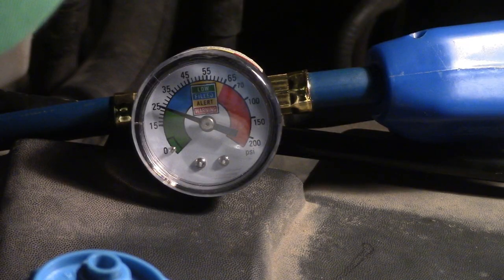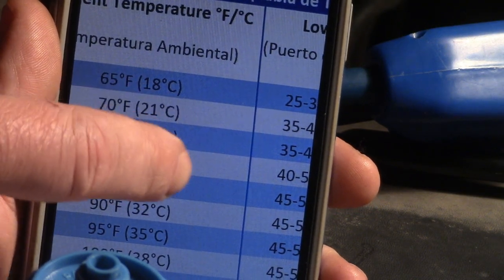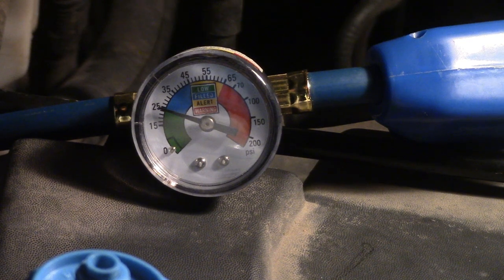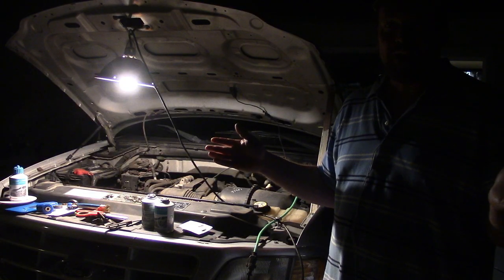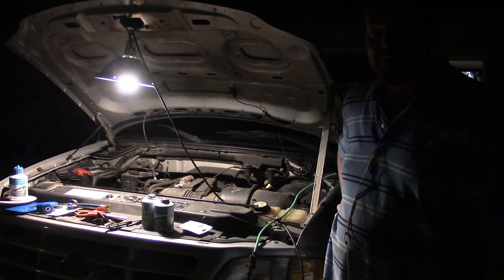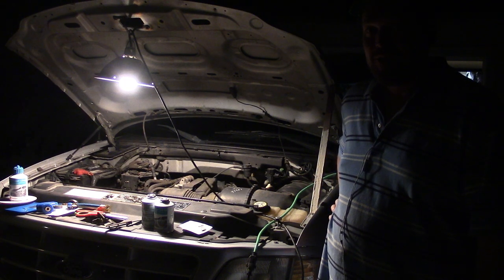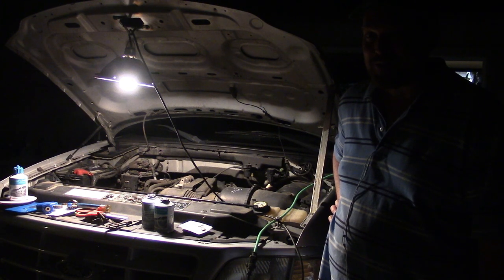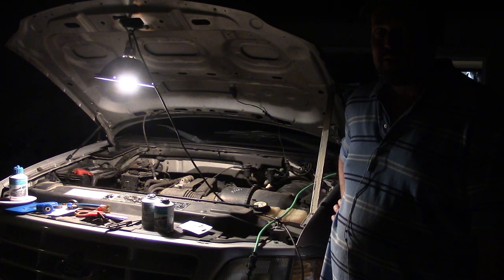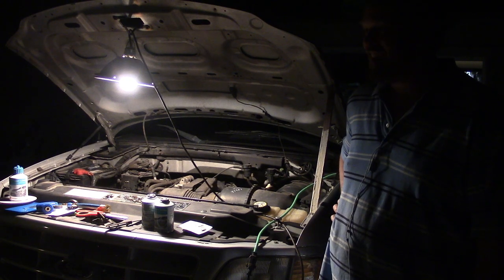If you look at the pressure, it's right around 25. Looking at this top number — 25 to 35 PSI low side — and we're just chilling right around 25. I think we did it. It took hours, but we did it. It took 3 hours to suck 33 ounces of vapor into the AC system, running through the pump as it cycles on and off. But it's blowing some frosty air on this 63 degree night. How much does the AC service cost? I think you can get a recharge with dye in it for about 75 bucks, so it's not worth your time if you make 25 bucks an hour.